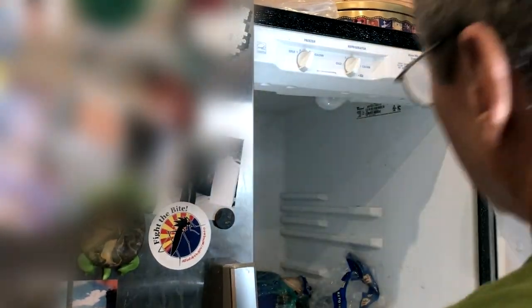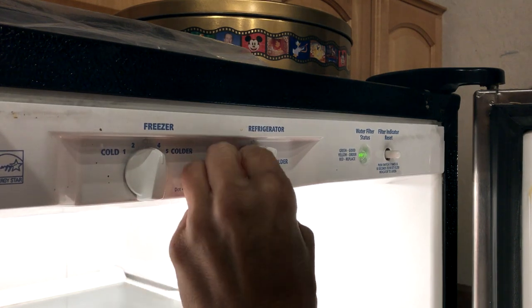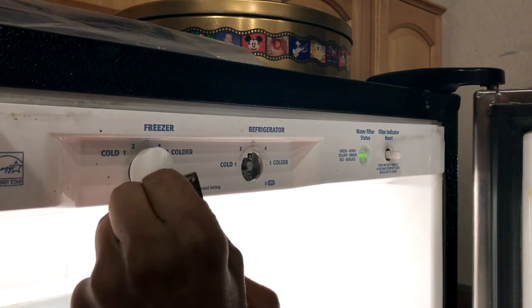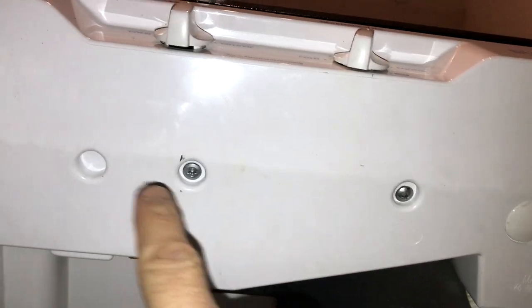Let's take this whole thing out — actually, let's unplug it first. Remove these knobs. I'd better also remove this light bulb. You're going to be taking out these quarter-inch screws. Don't take out the ones right here — that's locking down a circuit board. But you do want to remove these screws here in order to get access to the thermostat assembly.